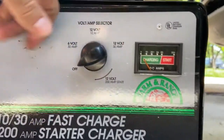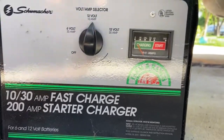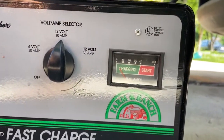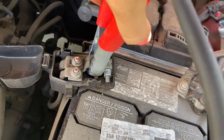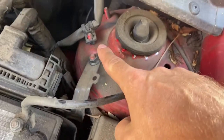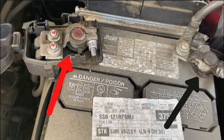I happen to have a heavy-duty multi-amp charger because tools are toys, and toys are fun. The nice thing about this is it can quick start a car like a jumper cable, or it can be used as a slow trickle. For the slow trickle option, I leave it on the 10-amp setting and leave it plugged in. Mine needs to be connected to the red positive terminal and a grounding screw on the body of the car, but some of the smaller chargers need to be plugged into the positive and negative terminals. Please just make sure you read the instruction manual for how yours needs to operate.